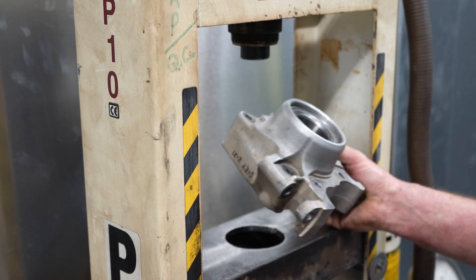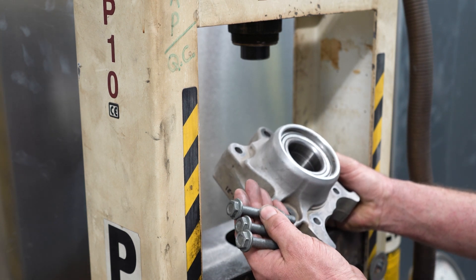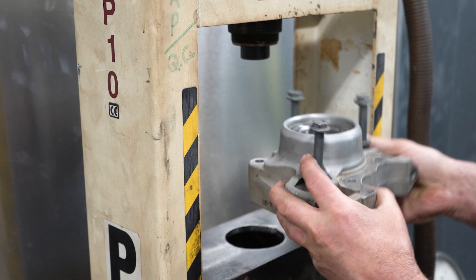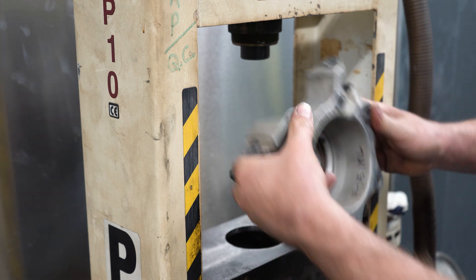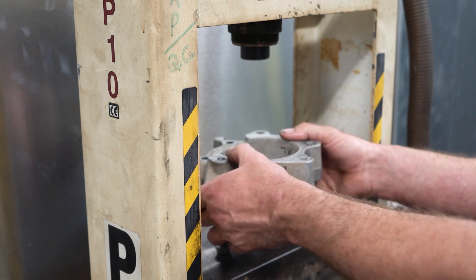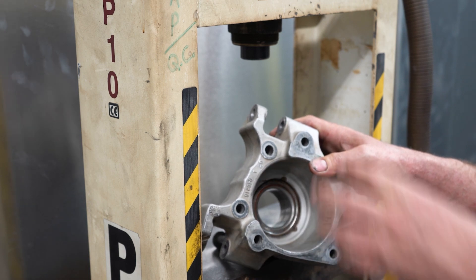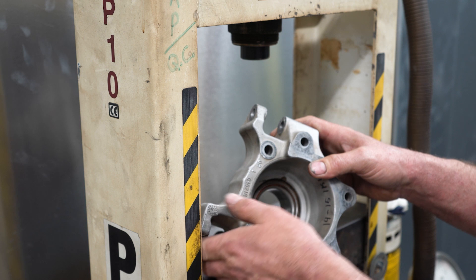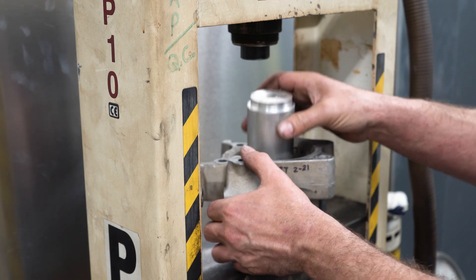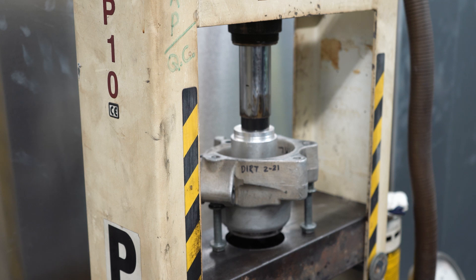A little trick for people that don't have a perfect circle cut in their table and are using just pressing plates: I've got three of the four actual hub mounting bolts and I use them to create an artificial table — that way I can use almost any shape table. We're going to be pressing right on the inner race in hopes that it will force the whole outer race out as an assembly. We set it on our table using a large pressing slug and just press from the inbound to the outside.